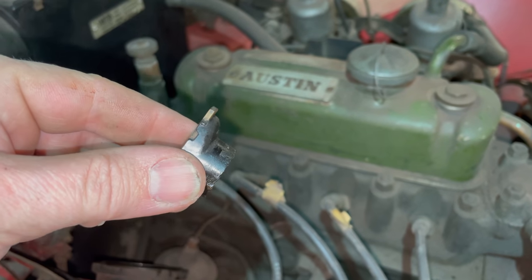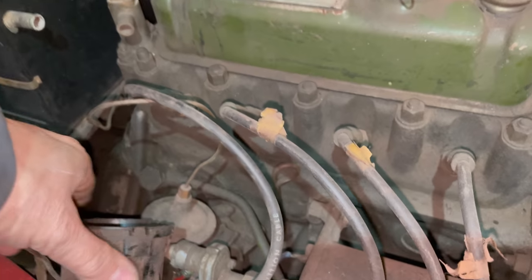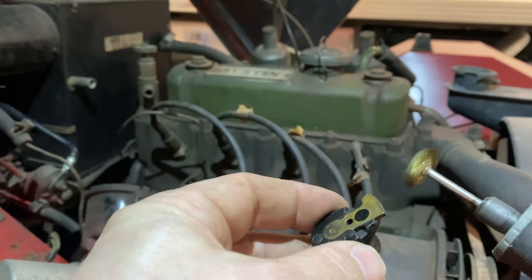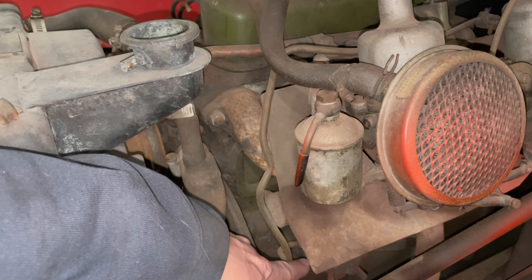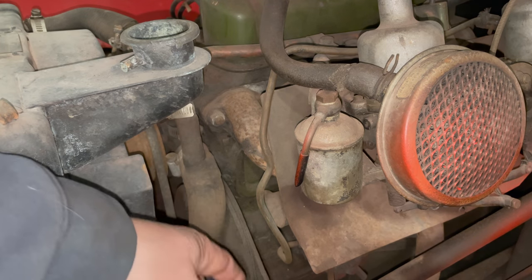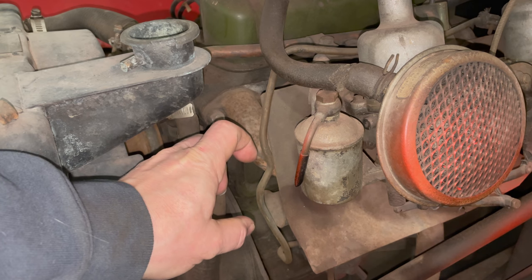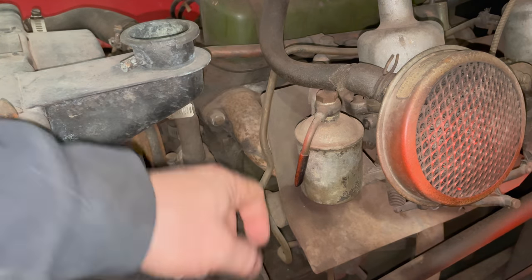Let's take a quick look at the rotor and cap before putting it back together. There's a little bit of dirt and corrosion on the cap - you can see the corrosion on the pins. For now I'm just going to clean these up and put it back together. Down here is the fuel pump, driven off the engine. This pipe supplies fuel up to both carburetors. I want to put an inline fuel filter here, so I'm going to cut this pipe to put in a length of hose and a fuel filter. It will also make it easier to test the carburetors by filling them with fuel and testing if the pump works.